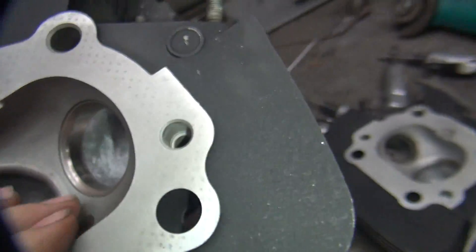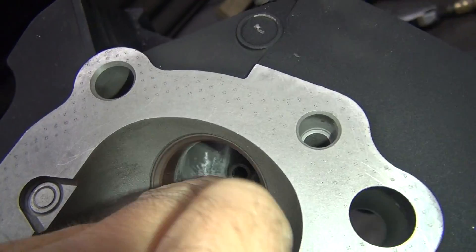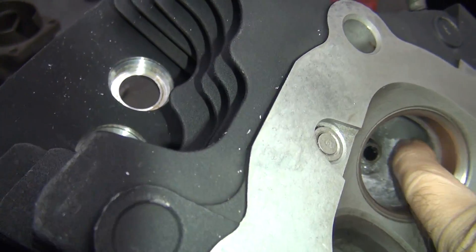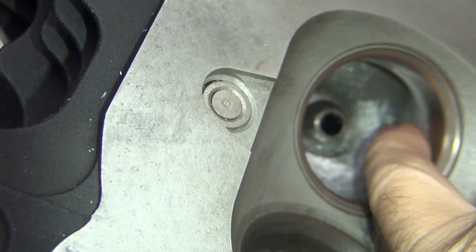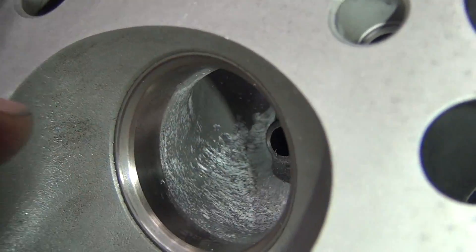On the exhaust part I just started working a little bit, so I knocked out some of the big stuff in here. I got the bowl nice and rounded all through here and cleaned up the sides over here where your finger goes down through. A nice good sweeping edge through here and radius it up underneath. This side here is a bit more open — just clean it up also.